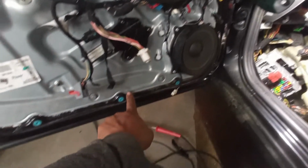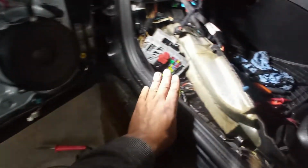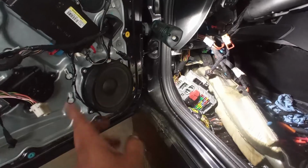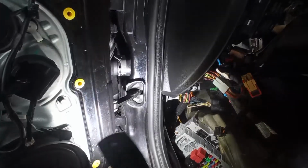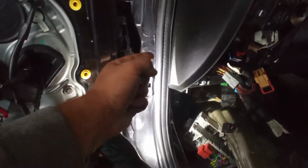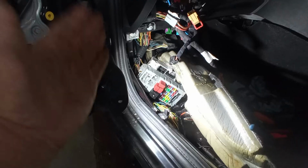If you have problems with water over here, I already have a video for that. This car has that problem. Water will be soaking this area, and that issue was caused because of this, okay? I'm almost 100% sure of that. Why almost 100%? I already seen on some cars, not this one, this rubber seal over here missing. If this rubber seal is not here, water will enter through the connectors, and the interior connectors do not have seals, and we have contamination on the wires.